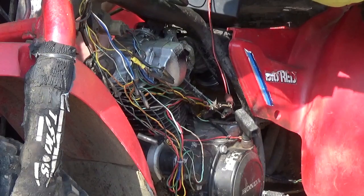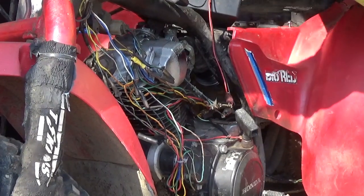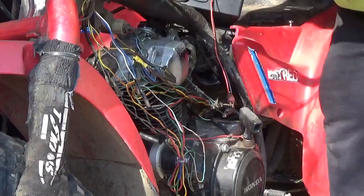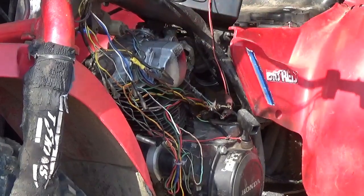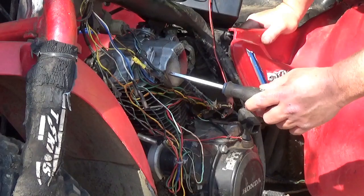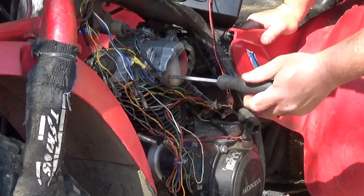I'm taking the spark plug out. This will ease compression, if you don't have to. And okay, let's see what we have. Yep, I have spark. That's all a very good thing. I'm also going to look behind this cover because they only have one Phillips head holding it on, and I just want to make sure that the advance isn't messed up and, you know, there isn't a frog or a lizard or something living in there.